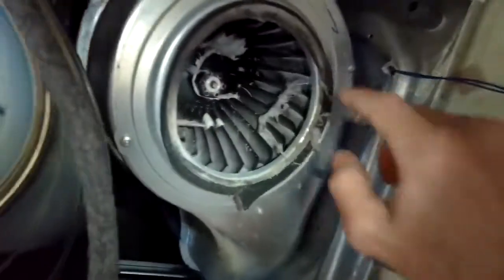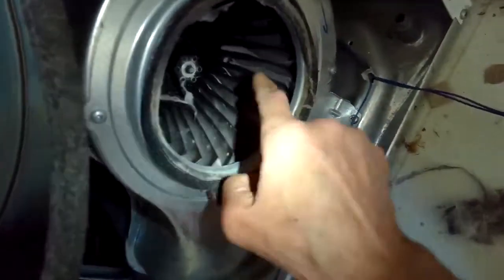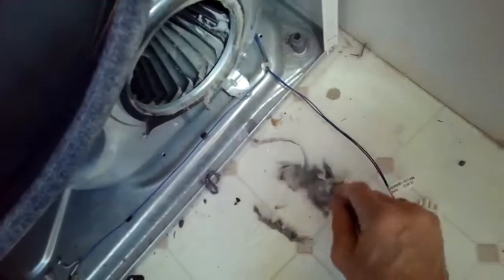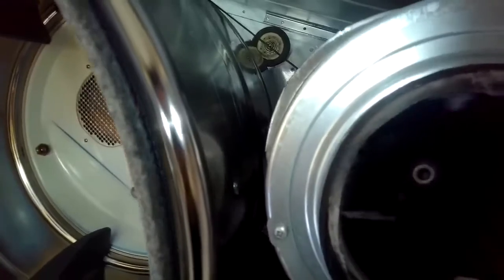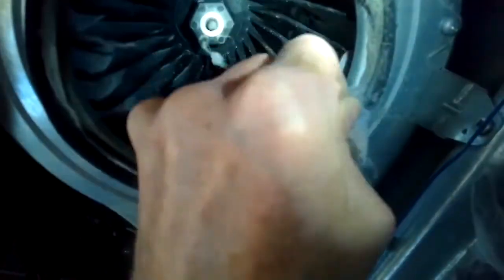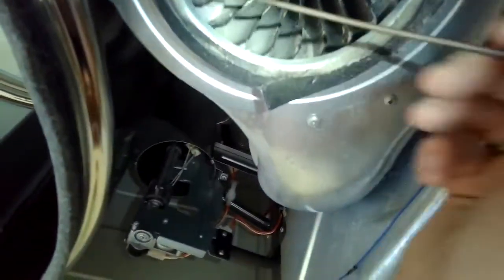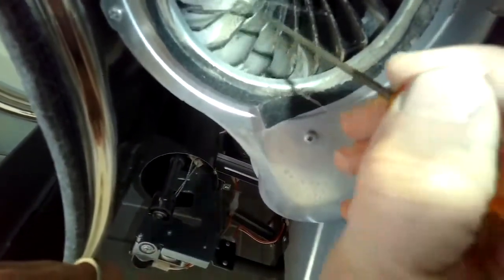I'm going to check those wheels and spin them to make sure that wasn't the source of the rumbling. There are also three wheels in the back — you can turn the tumbler and check for any sound or problem with those wheels. But in fact it turns out it's just all this crud that's built up through the years on the blower wheel. The blower wheel blows air through the system while the dryer is running, but the Electrolux develops this strange issue where lint builds up in the vanes — the plastic vanes — creating a terrible rumbling noise and really decreasing airflow.